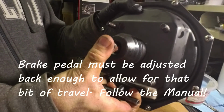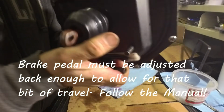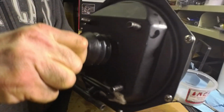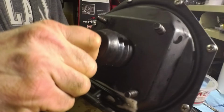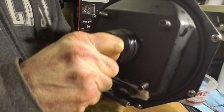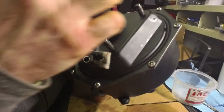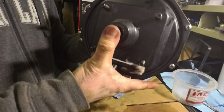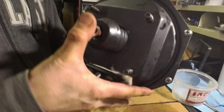It's like a switch. So there's a gap between a piece of rubber in there and an O-ring, and as soon as it shuts, seals, it lets the vacuum divert into this front chamber here, just like a switch. And what I don't quite understand is how the vacuum assists without overcoming. But I guess the valve body size, the orifice in there is so small, it limits it. But anyway, that's how it works. So if you jam on it, it's just assisting a certain percentage at a time.